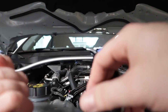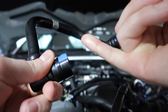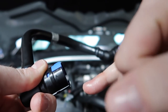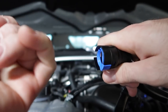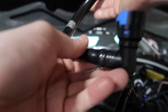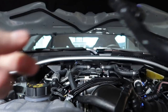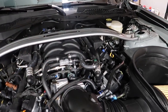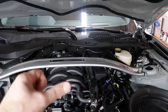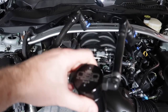Now if we take our stock one — I'm not lying to you — put a finger through and you can actually run through it. There's only about 50 miles on this car, but there is actually oil that I can get off my fingers. Yeah, a little bit wet. You know with mileage and as the oil darkens you'll really be able to tell. Oil does pass through these things and it goes essentially right back into your intake system, and over time with excess buildup it actually dilutes your octane level — and you want a high level of octane.